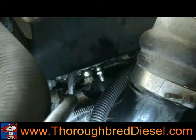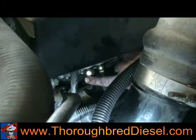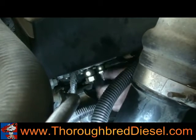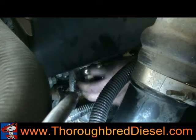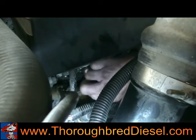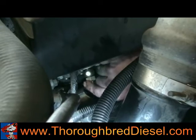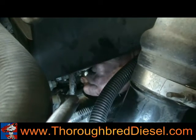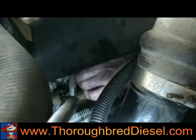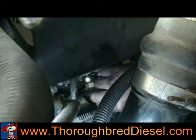All right, just bump it, Dave. You can hear the pump running. And we're just looking for fuel. Tighten it down, let it kind of create a vacuum, and then open it back up. Bump it again.